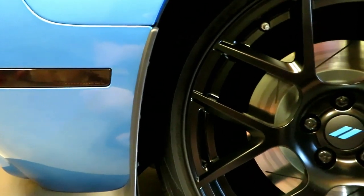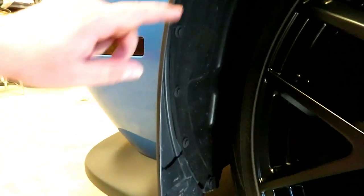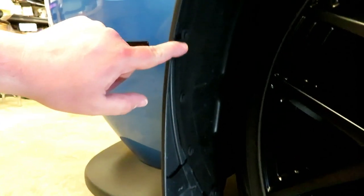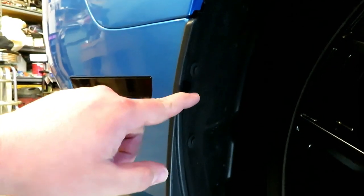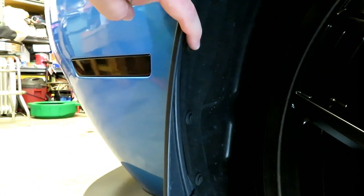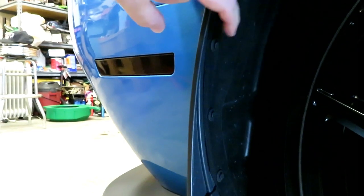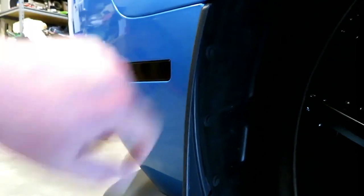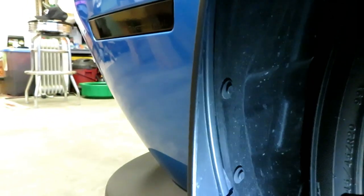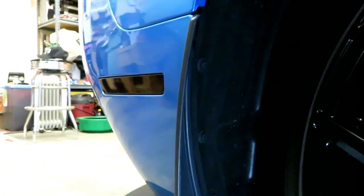Here we are on the driver's side. You're going to want to start your vehicle and turn your wheels to the inside for each wheel you're working on. Here is the front splitter or lip — you're going to have three rivets in it. I have pop rivets in mine because I've removed my front bumper before. The original plastic rivets have a hole; you can shove a small screwdriver through there, break that rivet, and then put in these quarter-inch push-pin rivets. I'll link those in the video description. We're going to need to take all three out.